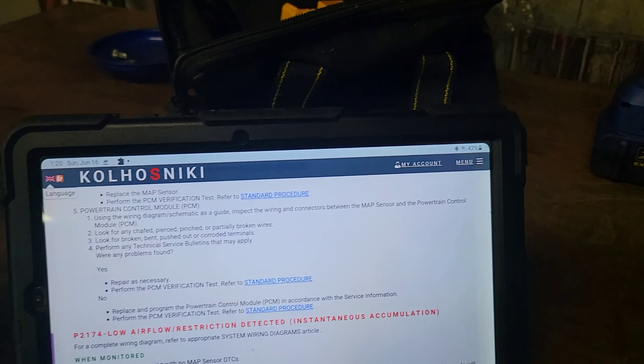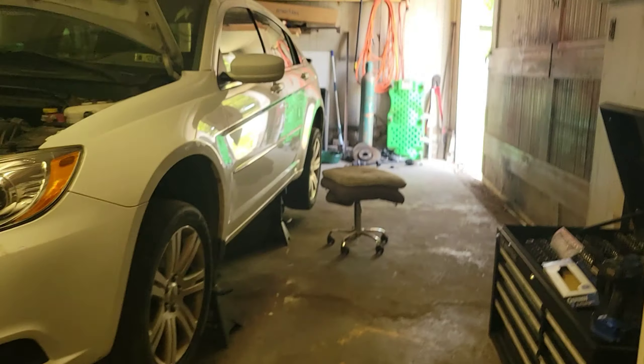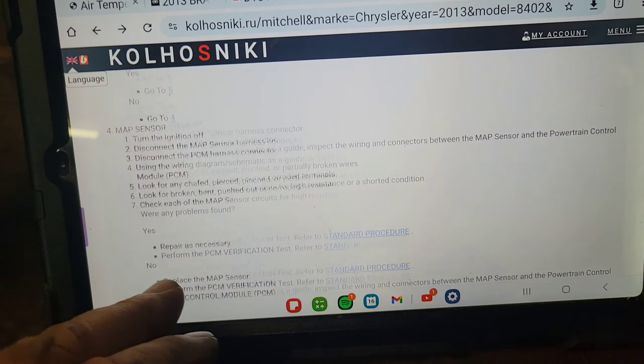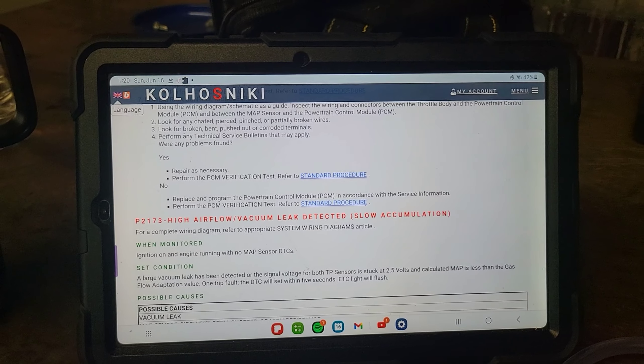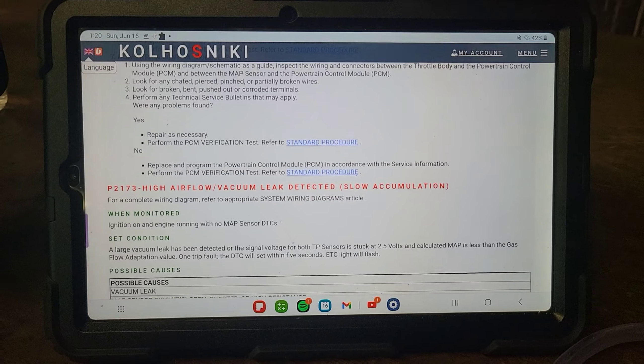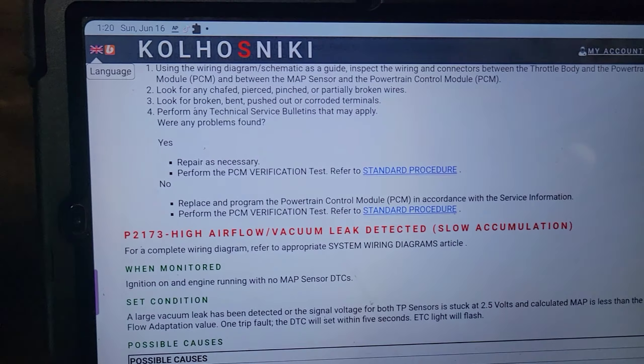Today I'm waiting for a bolt for Joe and Angie's Chrysler 200. It's coming tomorrow. Right now I'm looking at what used to throw this thing into limp mode — I'm hoping fixing the wires helps. I found a couple of bad wires and a bad O-ring on the MAP sensor itself. It wasn't torn or anything, but it was pretty flat. For the time being, I got an AC O-ring on it.